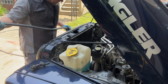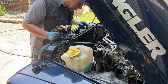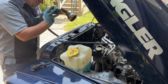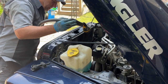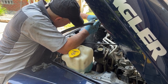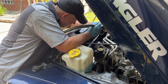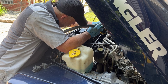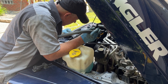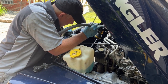I decided not to unbolt the condenser — I didn't want to mess around with it because I'm afraid if I break these seals I'm going to have problems with the air conditioning. So I'm just going to take the hose and rinse this thing out. The condenser core is pretty thin and there's a lot of white fuzzy stuff floating around. When this is all blocked up it also restricts air going to the radiator while you're driving.